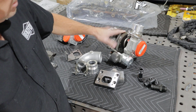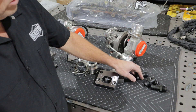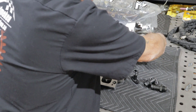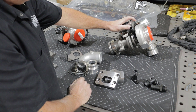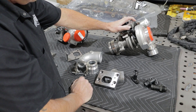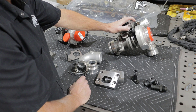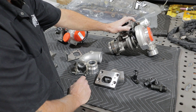For the drain size, whether it's a T25 chassis or a T3 chassis, I have standardized on 12AN fittings. This happens to be the T25 12AN fitting that I've had manufactured. The reason I went with extended fittings is because of clearance concerns on the compressor housing — if I went with a recessed or flush-mount fitting, I don't know that the diameter would even fit. 12AN is a little bit overkill for the 221 or 200 series in general, but standardizing across all the engine platforms and turbo models to the largest size is the best route to prolonged turbo life.